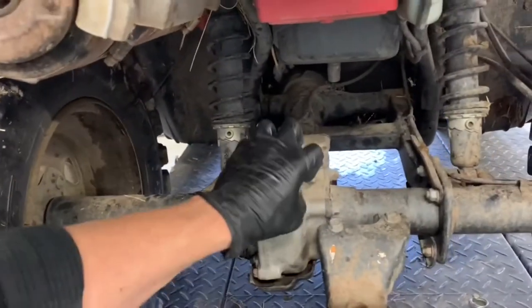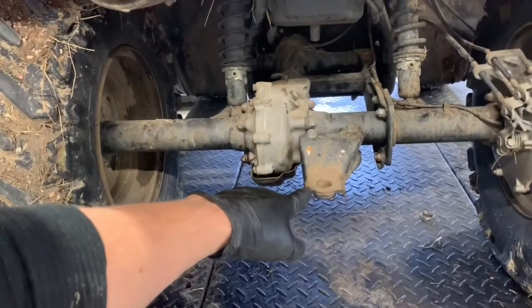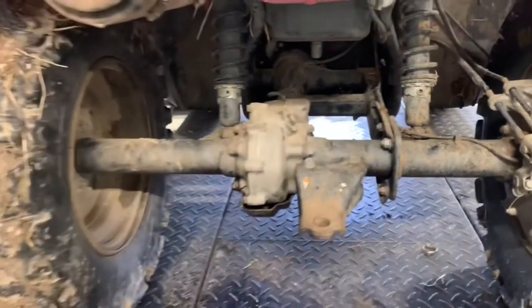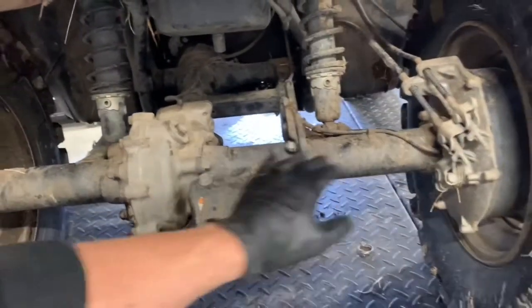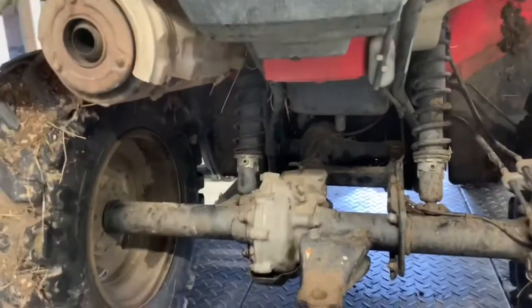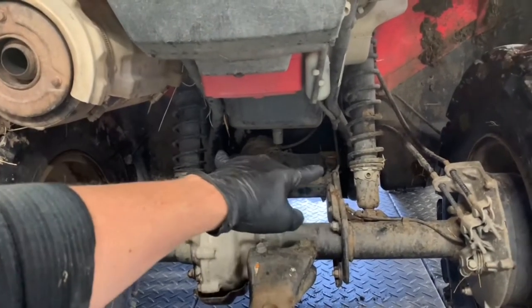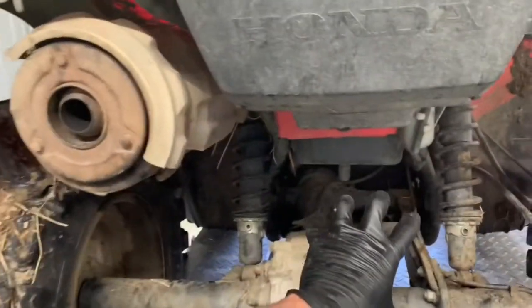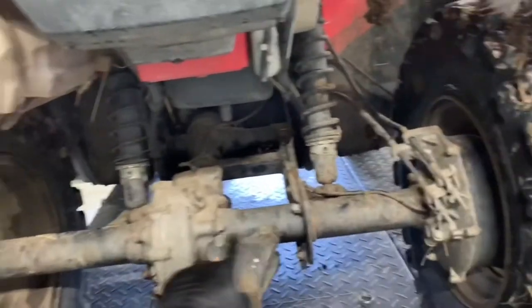I'll show you how to change oil on that differential in a separate video. We've got our trailer ball mount here — you can put a ball on here and pull a small trailer around. You want to be careful you don't put too much weight on that back end, as it's attached to the rear axle carrier and you could potentially damage some of that. Rear shocks are adjustable on this model — you've got two rear shocks. They do call this a solid rear axle, but it does have adjustable independent shocks. A fully independent rear suspension would have a differential here with a separate axle coming out each side; this is called the solid rear axle.